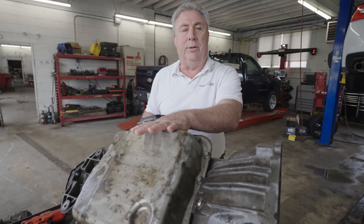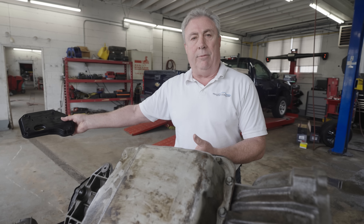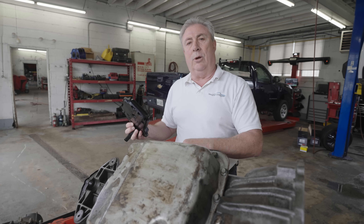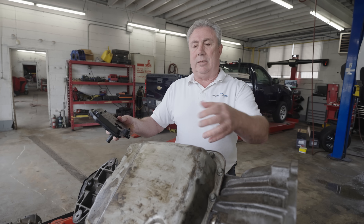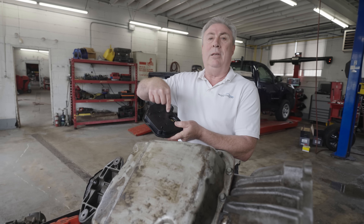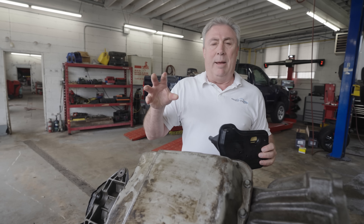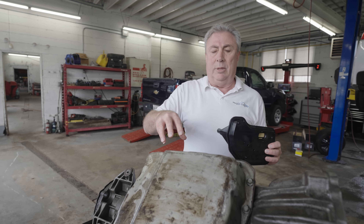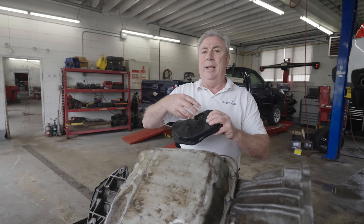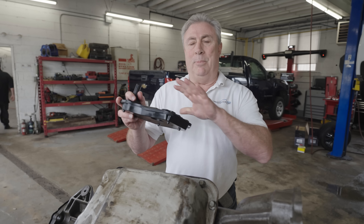In a transmission, it's more like an air filter — it's on the suction side, the pickup side. But where does debris come from in here? This is a sealed system. There is no debris floating around. The only thing we've really got is clutch material breaking up, and that chain-link fence mesh will not catch the clutch debris — it just flows right through. If you've got metal shavings in here, either the transmission isn't working properly or it's just a small amount of glitter — not enough to stop oil flow. So getting this as a point of service is a waste of time.